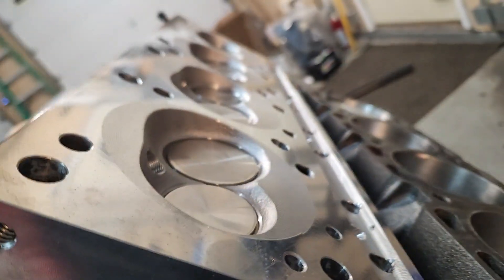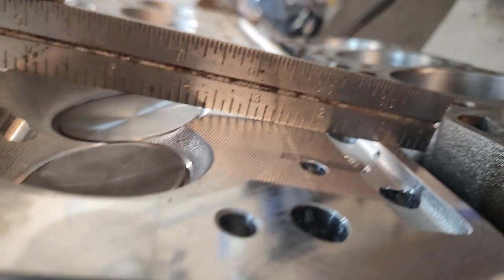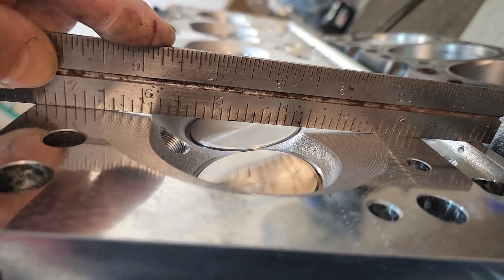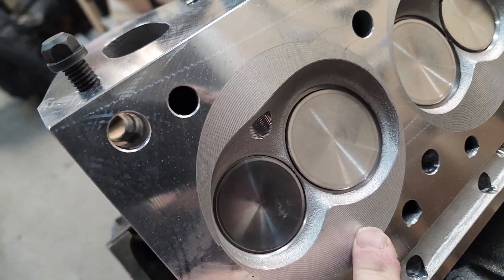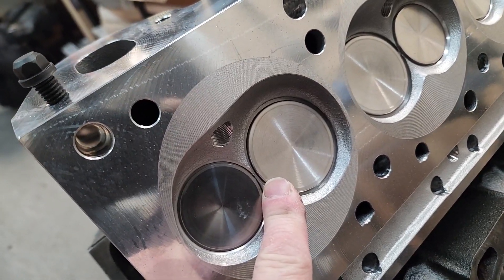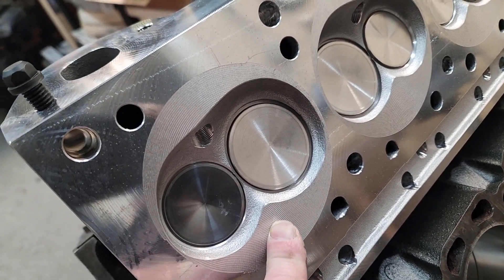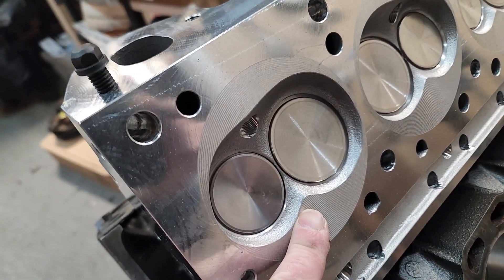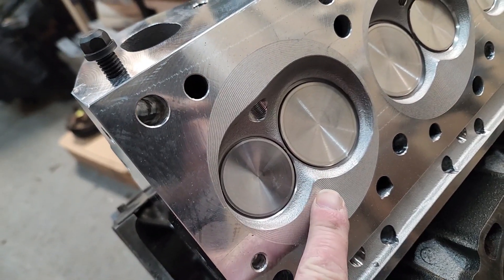Looking at it from the side here with my straight edge — we're on the flat surface of the gasket and you can see that it is angled and tapered towards the combustion chamber, towards the valves. Anything in this — sometimes you'll hear people say the squish area — you can see that compression is going to want to ramp towards the valves. What that allows you to do is have a much wider tuning window of ignition timing and suppress detonation, trying to keep it from showing up too early. You could actually run more ignition timing without getting into detonation. So that was one of the major things we had done — softening the chamber by angling and tapering this quench pad towards the valves.